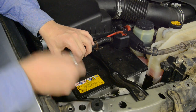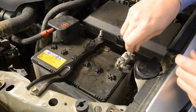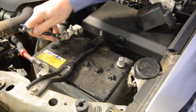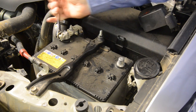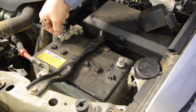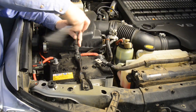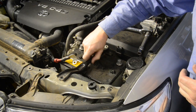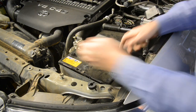You can then move on to the batteries. Disconnect the negative terminal of both batteries by loosening the terminals with a 10 millimetre spanner. With the negative terminal clamps removed, you can then disconnect the positive terminal clamps of each battery, ensuring the cables can't come back into contact with the battery terminals. With all electrical cables disconnected, undo each battery securing clamp using a 12 millimetre socket and lift each battery out of the vehicle.